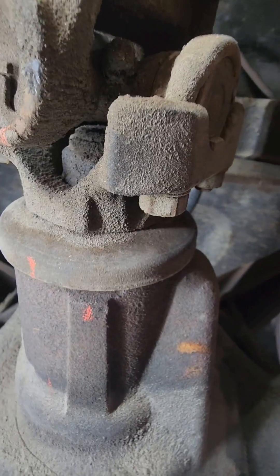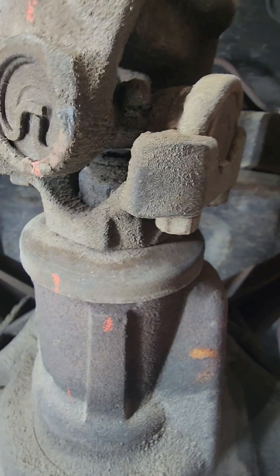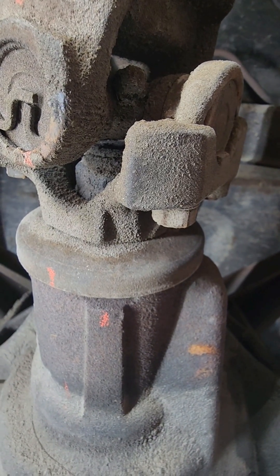As we can see, starting there, it turned three times and just a little bit more. In this case, we've got a 3.08 open gear.